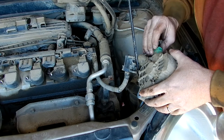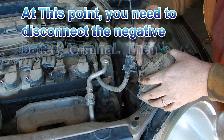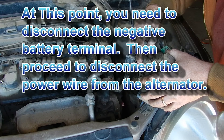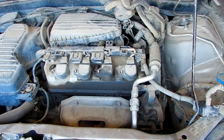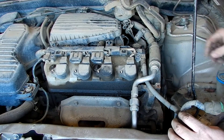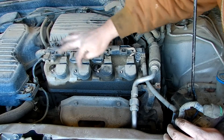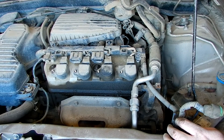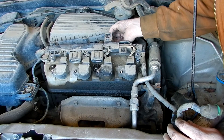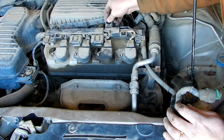At this point I might as well take the wires off the alternator because I'm going to have to pull all of this through to get it out of the way to get the valve cover off. First step: push down on this and pull this plug out. Now it's time to start moving all of this — we have to pull every single connection off of the spark plugs. There's a little clip right back here that if you jam a screwdriver in here you can pop that loose.